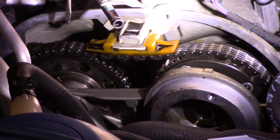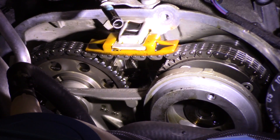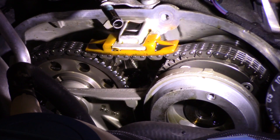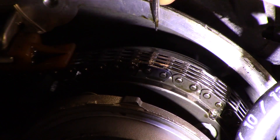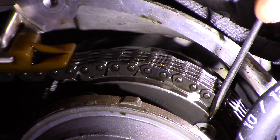There should be maybe about 11 or 12 chain links in between. When you lace the new chain it has colored links, and you just line up the marks with the links. But this car is going to need either a valve job or a cylinder head replacement, plus a new timing chain, tensioner, and guides. The cam-crank correlation confirmed that our intake cam was out, so honestly you didn't even have to do this. There's a little mark right here — our timing mark down here is way off.